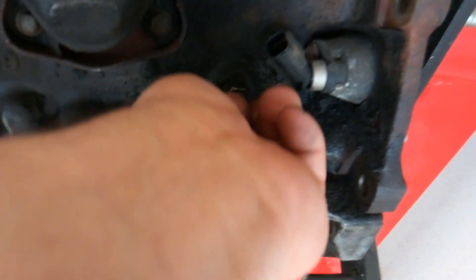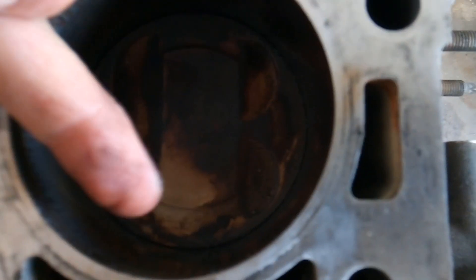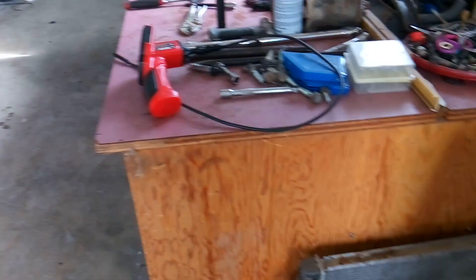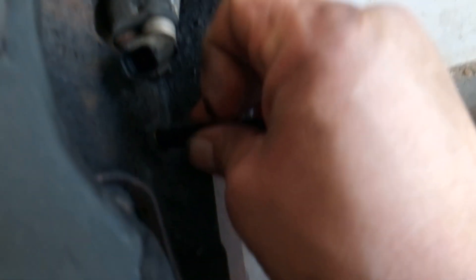The exhaust sits right here also. What you want to do is remove your plug — it's going to be anywhere ranging from a 10 to a 13 millimeter plug. Now you're not going to be able to see in there at all, but I'm going to show you what it looks like. Right now this engine is not set to TDC, so you can look at the piston and see that it is not all the way up flush. I've got my inspection camera out and inside of this hole, if you look at the screen, you can't see anything — it's just like a black hole. That's because this engine isn't set to TDC, so there's nothing there for your pin to lock into. Let's go ahead and get it set to TDC and take a peek at what's in there.